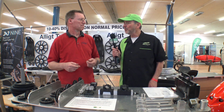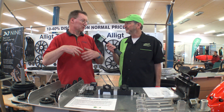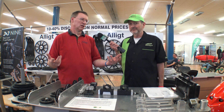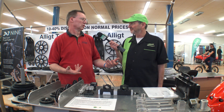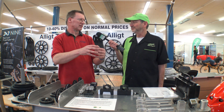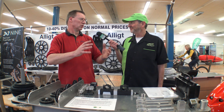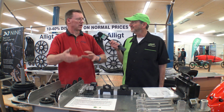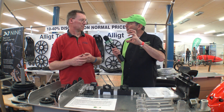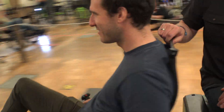This pedal generator actually replaces a chain. If you're thinking about three- and four-wheelers and cargo bikes, they have very complicated drivetrains, and this can be an economical solution to replace the drivetrain. If you have a rented fleet, you can make quick adjustments, less maintenance, and more control by the manufacturer over what's happening with your vehicle. To be clear: you pedal, it drives a generator, the energy goes into the system with a battery, and then the motors are on the wheels — that's the propulsion system.